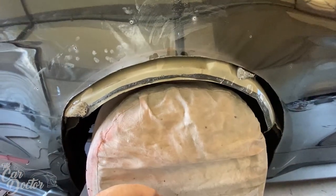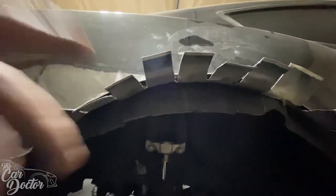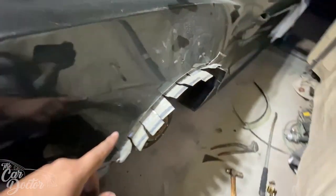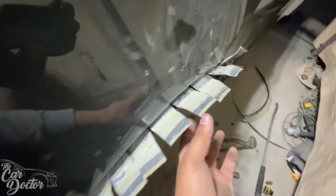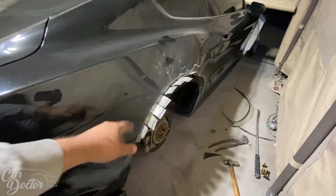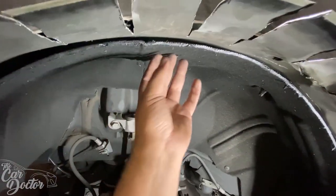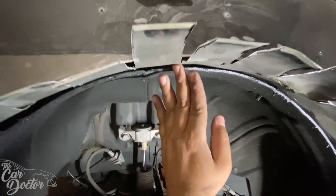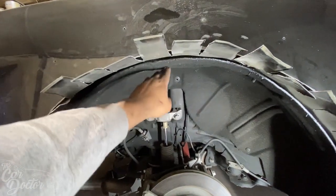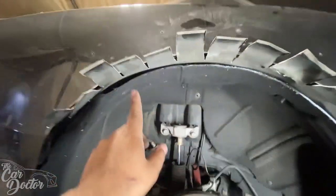That's how it should look after cutting the first top layer and taking it off. I got the rear quarter panel cut a little bit extra to where it's pretty flat with the area behind it. Now I have to bring it all up, grind it down flat, weld it, chop it off, and seal it up. I want it perfectly flat with the top — that's literally the farthest you can go; any further starts angling weird and the wheel would touch anyway. It's looking nice and smooth, the top is matching up and lining up pretty nicely.